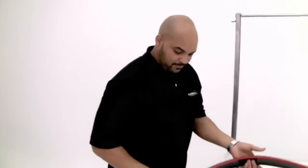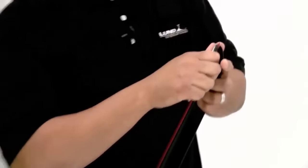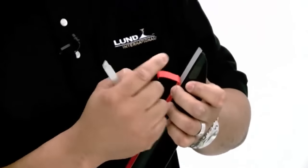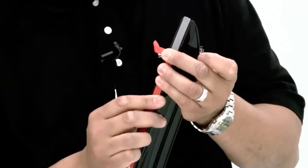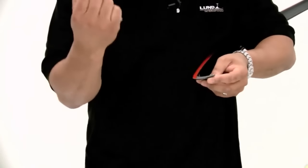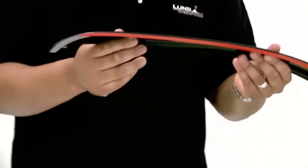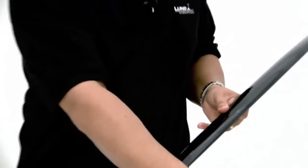I always start with the front visor first and use it as a guide for the rears. Pull back the tape — don't pull it all off. Pull it back about two to two-and-a-half inches and fold it outward so it's hanging out like that. I do both ends like that. On the short pieces, just go ahead and pull them off since they're not hard to attach, but make sure you get all the protectant off before you attach it.